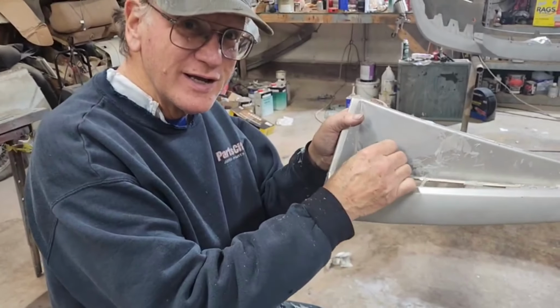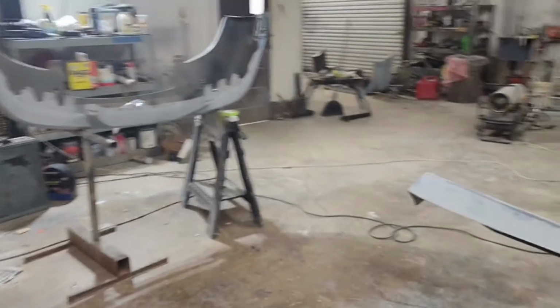Finished the paint job yesterday. Scratching it off today. Oh boy. How did the Mustang turn out? It dried out a little bit on us. It's orange peely looking. Oh, is it? What we got to do about that? Kind of like we're planning, just color sand and buff. Oh boy. Our cleanest paint job. Wasn't going to have to touch it.